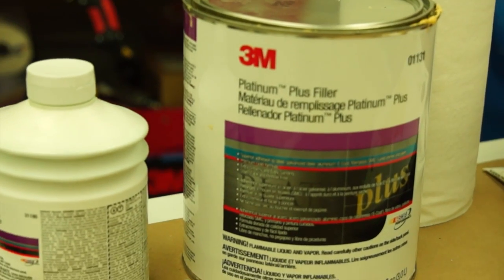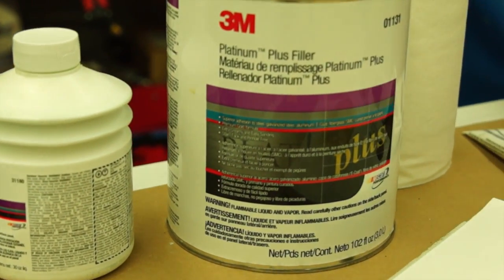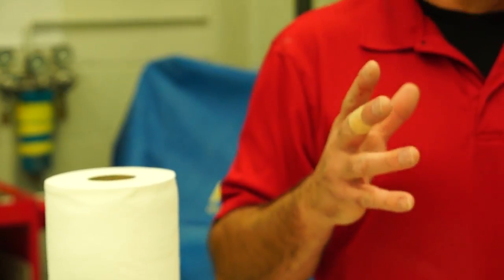When you add too much hardener, basically what's going on is you're going to put unreacted material into the mix. The hardener is designed to react entirely with the whole amount of filler that's there. If you add too much, the hardener reacts with the filler and then there's residual hardener left over — unreacted benzoyl peroxide. That material can cause staining, poor adhesion problems, and internal failures within the filler itself. Those are all bad things, so we don't want to go down that road.